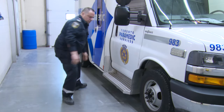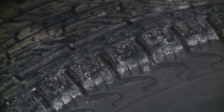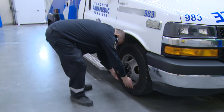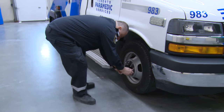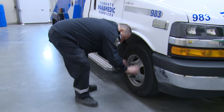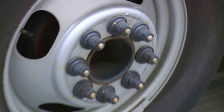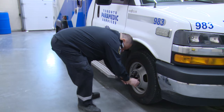Check the right front tire for any abrasions, bruising, cuts, or pieces missing on the outside of the tire and on the tread. Check the rim of the wheel for any damage, bent or sharp edges, or signs of scraping such as paint that has been removed. Inspect the fastening nuts on the wheel for any signs of back-off where the wheel stud threads are exposed.